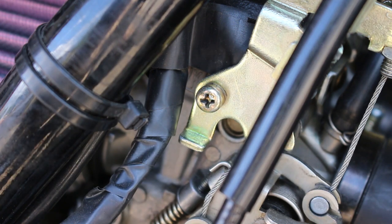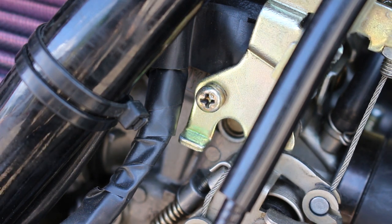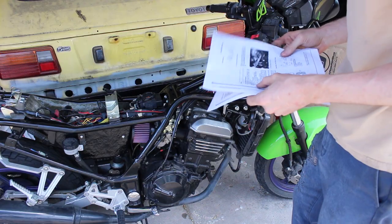Phillips, you know, kind of a wedge on them. So when you twist, they wedge out and strip easier than J.I.S. J.I.S. do not have a wedge, they're straight cut. There's a lot of videos on it, you can look it up, but I'm definitely gonna get me a set of J.I.S. screwdrivers, because it looks like a lot of these screws are J.I.S. So just a heads up on that. They're probably number twos, it looks like. They're pretty close to number two Phillips, so probably get number one, number two, just to be safe, but just a little tip for you.